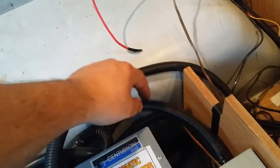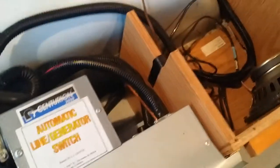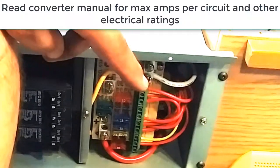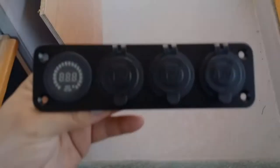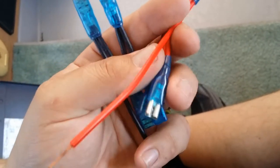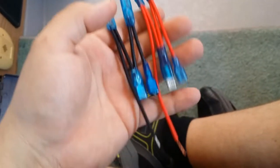This is where all the DC 12-volt lines run. I went ahead and pulled all the electrical tape off the plastic conduit so I can run more cable. That's going to become a 20-amp circuit with the new red line. There are a couple of other open circuits I'll use to run the second workstation line. I'm going to wire up this wiring harness in parallel — it came with slidable plastic insulators which I'll remove. I've got some heat shrink tubing; I'll put it on and crimp the leads to my lines.